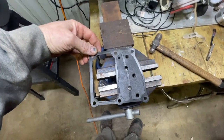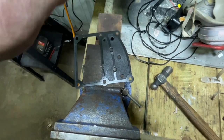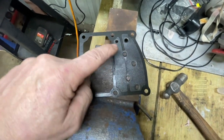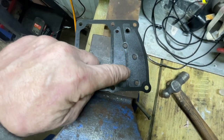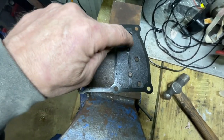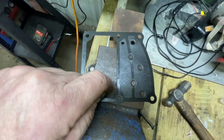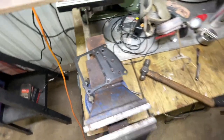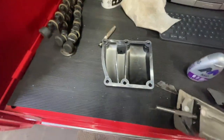Here's what I came up with: I put three holes to open this section up to allow the oil that comes in from the top to drain back into the crankcase. Then I put a hole here and here right on this seam, which is basically going to create an opening between this chamber and this chamber. I think that should be plenty enough to allow the pressure to release and vent out. Worst case, if I have an issue, I just get a new gasket and everything goes back to normal.